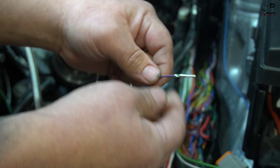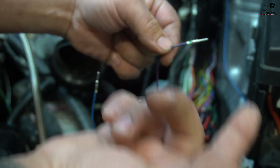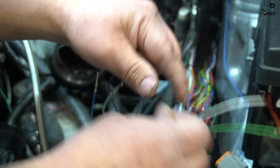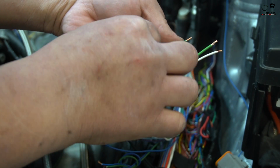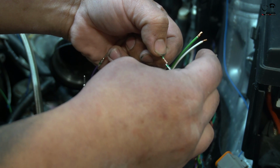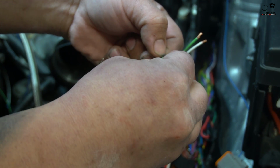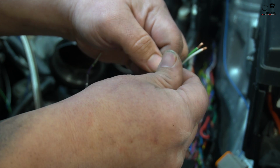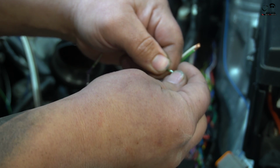The last thing you want to do is have one of these crimps come loose and one injector is not firing and you toast the motor because of it. So that's why I like using these. We'll do it again, show you guys real quick. This is not a factory connector. I mean, they should be, because they're actually better than factory connectors, because they're double sealed to make sure that water does not get into them.